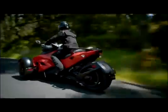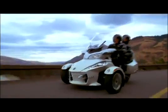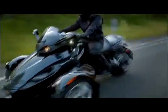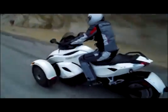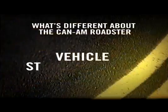This 3-wheeled Y configuration provides greater low-speed stability than a motorcycle, and when stopped, it is more stable than a motorcycle. But 3 wheels are not as stable as 4, so it's not as stable as an automobile. So don't think that you cannot tip or roll it. If you make extreme maneuvers or strike uneven surfaces or objects, your vehicle may tip or roll over. It's also possible for you or your passenger to fall off due to hard turns, acceleration, braking, or impacts.